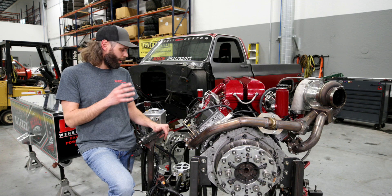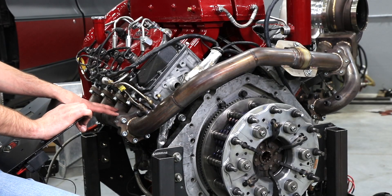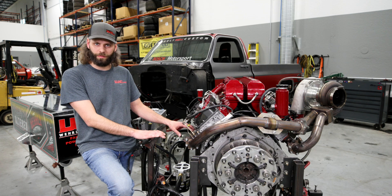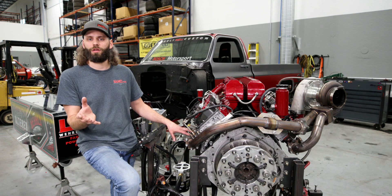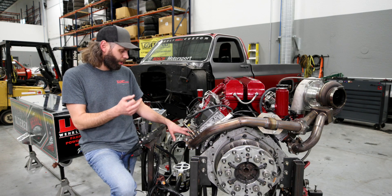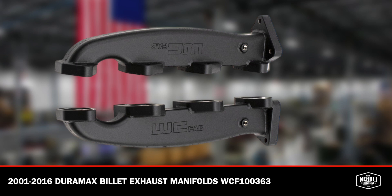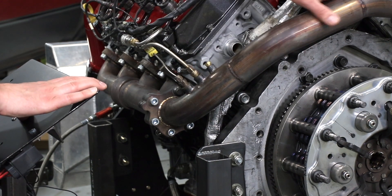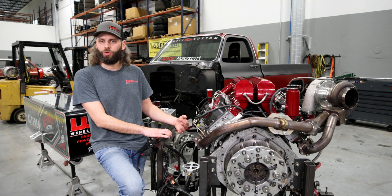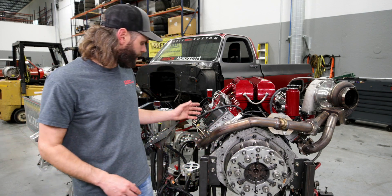We spun around the motor to show you the exhaust side of this setup. This engine still has our fabricated two and a quarter inch headers on it. We do offer billet steel exhaust manifolds for 2001-to-current Duramax, however only in two-inch size. For pulling applications, we like to run the two and a quarter inch diameter, and we don't have the billet steel ones available yet in that larger size. So for full-on pulling, we're running the two and a quarter inch through our custom two and a quarter inch remote mount turbo setup. We can also build it in two inch if you're running a 2.6 charger style setup and don't need the larger manifolds — we'd use our billet steel exhaust manifolds with two-inch piping.